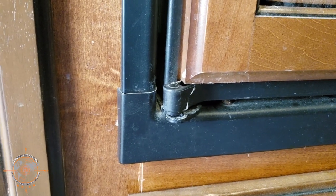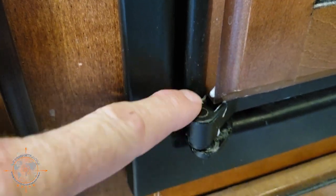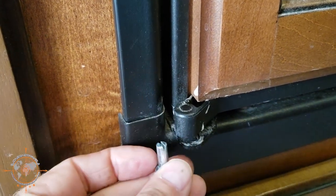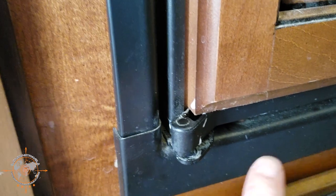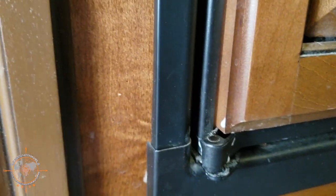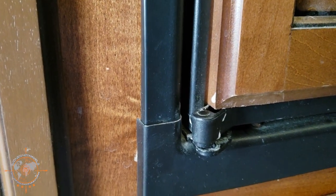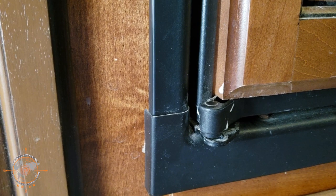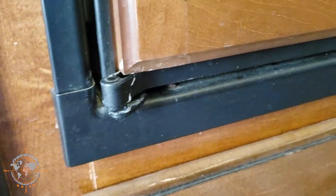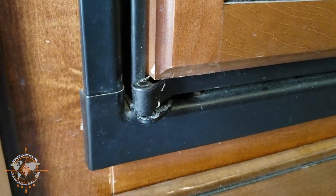So basically this Norcold fridge has this little plastic piece and this pin. This pin is threaded onto this metal bracket and it goes up into this plastic piece. Well, it broke off — this whole piece broke off and I glued it with some Gorilla Glue but it's not going to be near strong enough. So right now the only thing holding the door on is the pin in the top and the fact that it's pushed against the seal closed. But you can't order this bottom piece. You can order the end pieces on both ends but you can't order the bottom piece, and this little hinge point is molded into here and it just broke off.